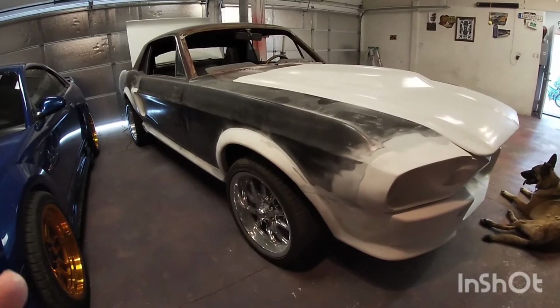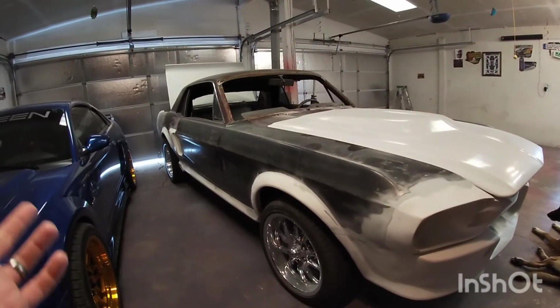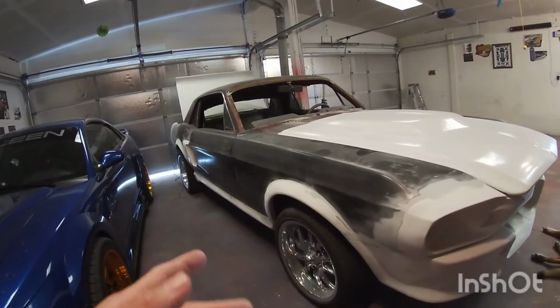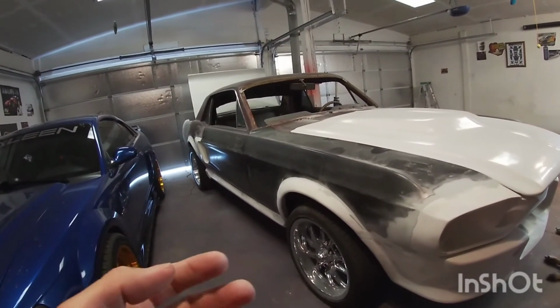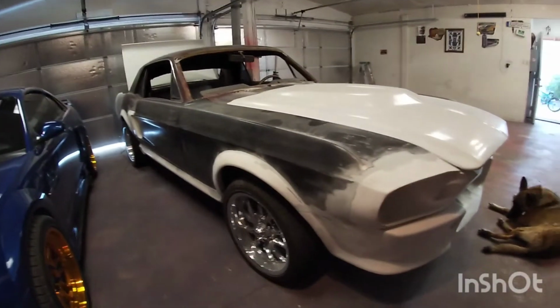And then I think I'm also gonna go up to 400 by hand, the whole car. That way when I spray the primer, I know I'm gonna have, well, I hope I don't have a lot, but I am gonna have scratches from the sandpaper and all that. But hopefully the primer will build up. And then after I prime, I'm only gonna be using 400 and up paper. That way I don't get scratches showing through the paint.